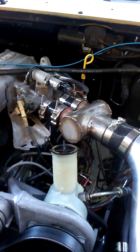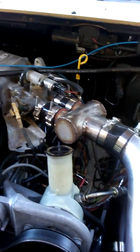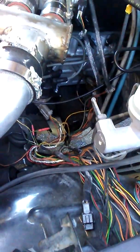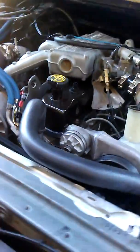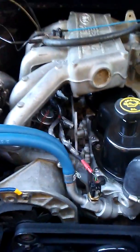There's a little throttle body adapter there. The single throttle body — I haven't quite finished with the adapter plate, so I just kind of whipped that out real fast to get that done. As far as management right now, I had to pull the Megasquirt out — you can see my harness is all opened up there. I have to change injectors once more. I had 47-pound injectors because I plan on running methanol on this thing eventually. But right now it will kind of fire up and run, but it's still a little rich.